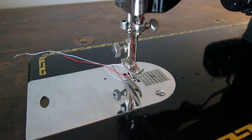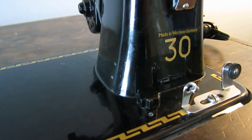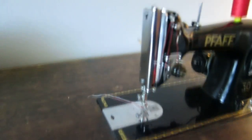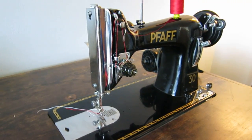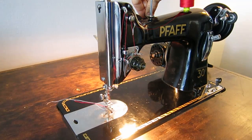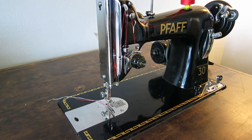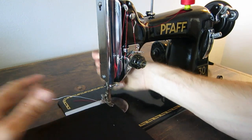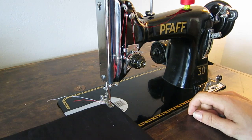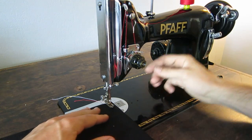The whole thing is excellent. I adjusted this one — it's got really high presser foot lift, it's got the narrower foot which I like, that's found on like the Singers. It's got a narrower foot, open toe in the front so better visibility, more aggressive industrial-style feed dogs. It's got a drop knob on the top so you can drop the feed dog for free motion embroidery, and it has an automatic bobbin winder and two spool stands. I just figured I'll do a quick sewing demonstration so you can see and hear how this thing runs.